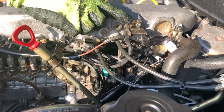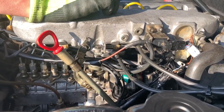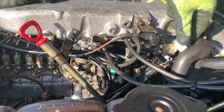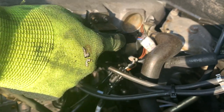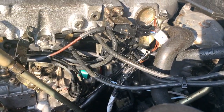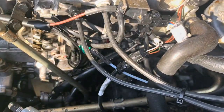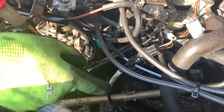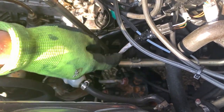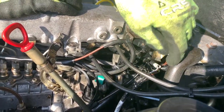One more important thing is that the wiring harness plugs need to be in the right position — this caused us a lot of hardship figuring out. This plug here has a blue and a brown wire; the one with two wires should plug into this plug here, and this is where it receives a signal from your key to turn the vacuum on for three seconds. We mixed this up with this other plug, which has three wires — a white and two browns — and this is the one that runs your RPM gauge. This thicker wire runs down to the transmission, and right where it connects to the flywheel is where it gets the speed sensor from. This will run your RPM gauge as well as your fuel consumption gauge, so if those two gauges aren't running when you're driving, try swapping these two plugs.